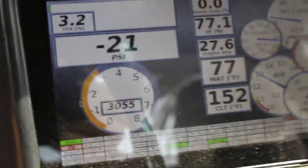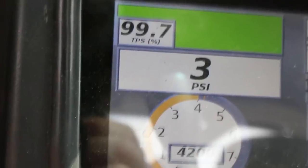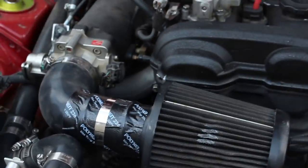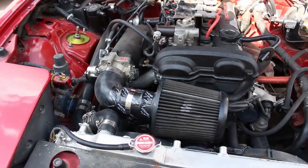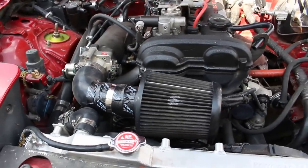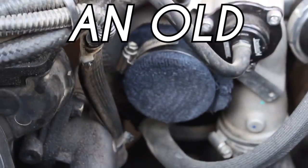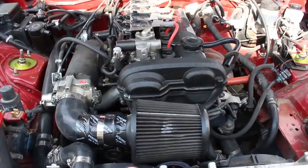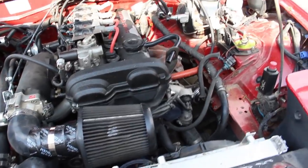The EFR just spools too fast and too easily — the propped-open wastegate is not going to work. This video should actually be called 'How to Remove 300 Horsepower from Your Miata,' which is essentially what I just did. Now we just have a little short-ram intake, and on the turbo an old sock hose-clamped on there so the turbo doesn't suck anything big in — because it's still going to suck. It'll probably be pretty disappointing to most of you, but I find this stuff very interesting.